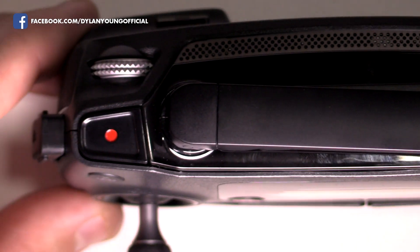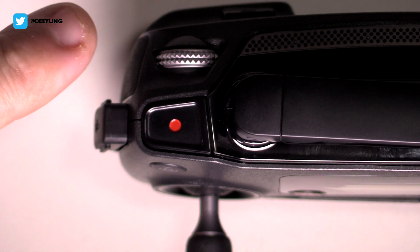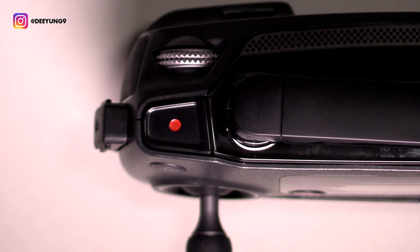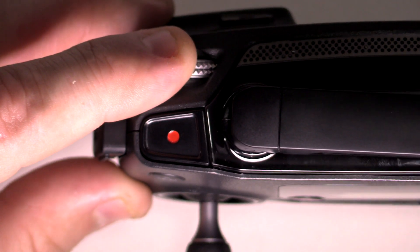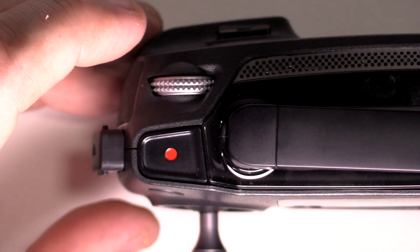Shifting the remote over to the left side on the top, you have your gimbal wheel. What that does is change the pitch of your gimbal. So when your drone's up in the air, whether you want to shoot straight ahead or tilt it all the way down, it can show you your view from right above pointing straight down, or you can tilt it out and do 45 degrees. You just wheel it left or right — that's all the gimbal wheel does.